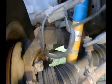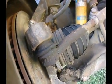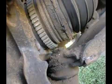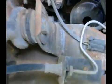Bumper's trimmed for oversized tires. Not as nice a job as I would have done. I would have gone down a little straighter. Anyhow, gotta get a brake hose and Moog tie rod end. Not greased though. When these have been greased. So tighten everything up. Idler arm's probably loose. Vacuum pump junk.